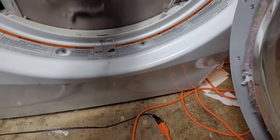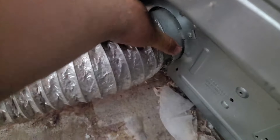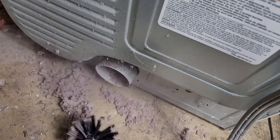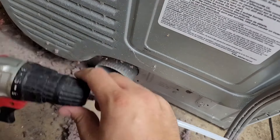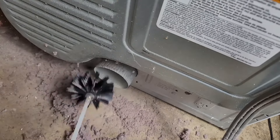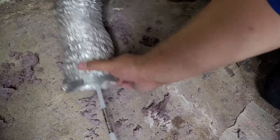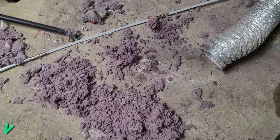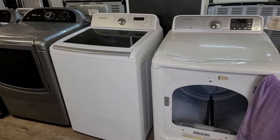The dryer's lint filter is awful on this one. I decided to clean this dryer out for my family member because they were in the ICU for two weeks with COVID. Taking the dryer vent tube off, the brush kit didn't get all the way down to the end of the vent, but I assumed that was going to happen. There's an incredible amount of lint in the dryer's internal vent pipe — I cleaned out probably a pound just from the tubes alone downstairs. The brush kit continued to pull more and more lint out. This is all the lint from downstairs cleaning, but the pipes are now finally in great shape.